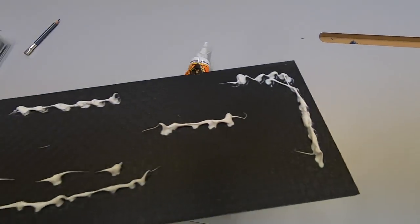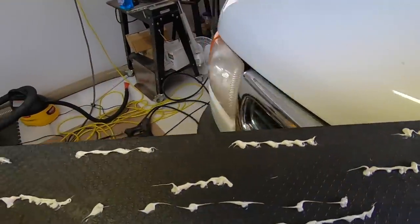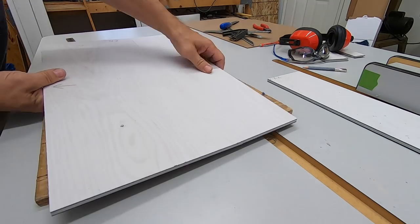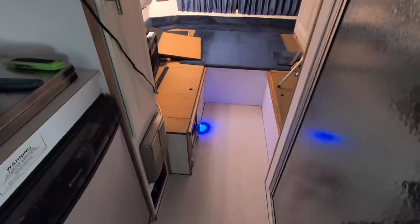Something not commonly used in floor installation is glue, but I used Gorilla construction adhesive for a portion of the step-up as you get into the van — that was probably the best way to handle it. I stuck it right against the vertical ledge and even used some brad nails to secure it in place, and used the same method for the step plate. For expansion joints, a normal room calls for a quarter inch around the edges, but since this area was much smaller I left them at about an eighth of an inch. And since this is a moving vehicle, I strategically filled some of those expansion joints with silicone caulking to hold it in place and give it a little sponginess to expand if needed — the vibration of bumping and turning can cause it to shift unnecessarily.